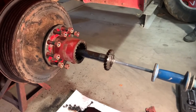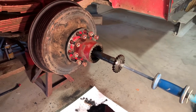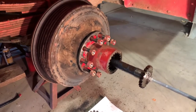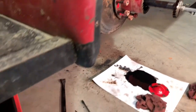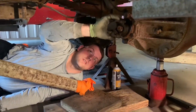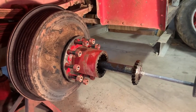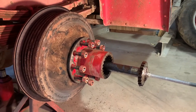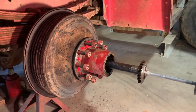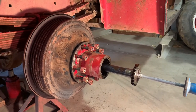Just to eliminate the possibility that we were banging our heads on the wall for no reason — we brought the axle puller here, pulled the axle out, disengaged the splines on the hub, and the drum is still locked. So we have eliminated the possibility that it's something with the actual differential carrier itself. Mr. Tabor underneath can show you that once we pull that off, the carrier differential is turning free — so we know that's not locked. The other drum is still locked. The chances of the bearings on each side both going bad in storage are fairly insignificant. So we're going to continue with the assumption that it's the shoes on the drums and work to get those broke loose. The heat and the larger hammers didn't work — still trying to break this loose without breaking things.